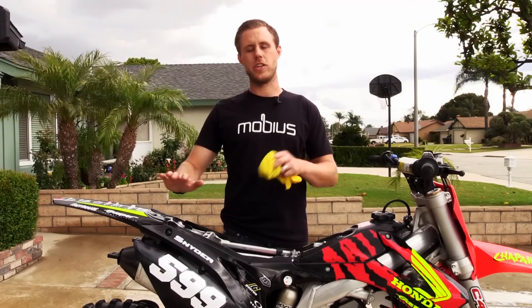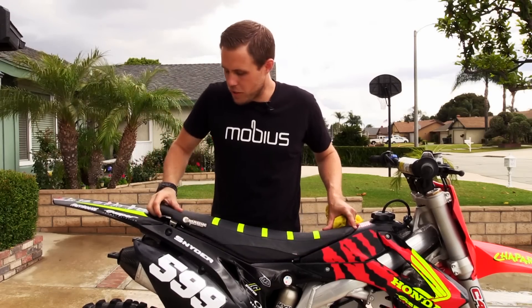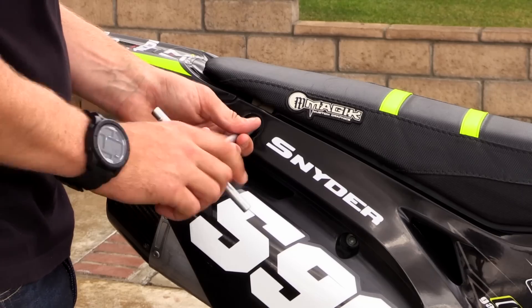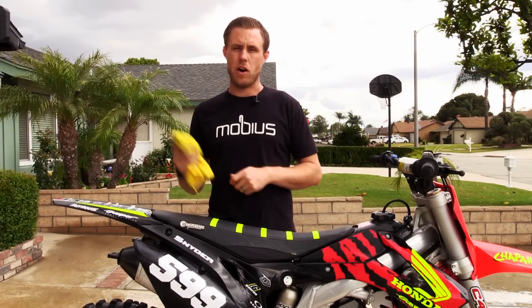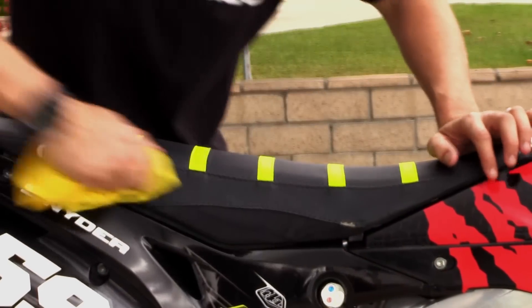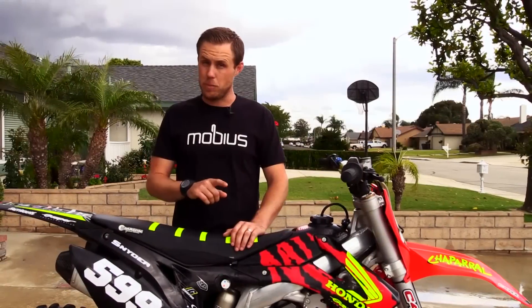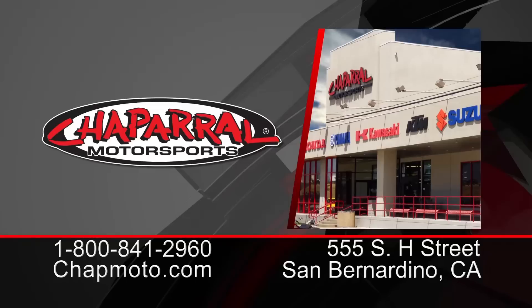The plastics are conditioned, so let's put the seat on. Since I mentioned washing the bike without the seat, now is the time to clean it — it's just easier to clean the seat when it's actually in place. You can throw some soap and water on a rag and wipe it down. There you have it — one way to wash and maintain a dirt bike. Don't forget to lube your chain, and if your air filter needs to be replaced, do so. For any more details, refer to your owner's manual. I'm Travis with Chaparral Motorsports — don't forget to subscribe and like this video. See you next time.